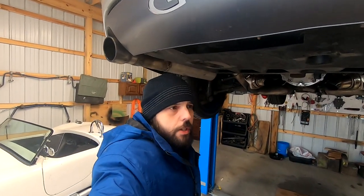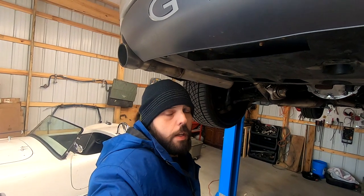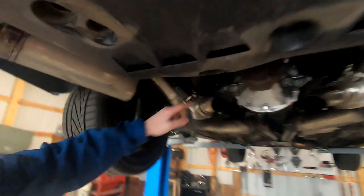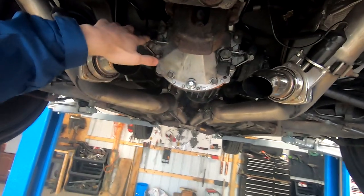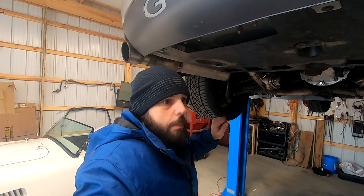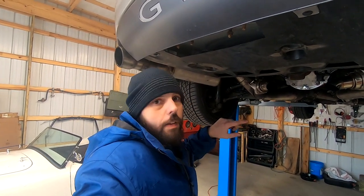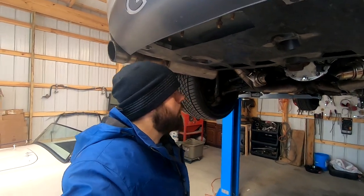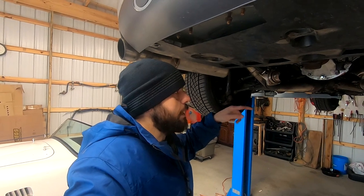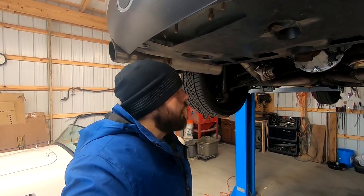Sorry for the continuity change — I'm bundled up today because it's under 30 degrees and pretty cold in the shop. While I was editing this morning the parts arrived, so I rushed out and got it done. The speed sensors are in. I had to use different bolts than the OEM ones — they were allen head and I was worried that if I had to pull them out in the future they might snap or round out. With a 10mm head versus an allen head, if these snap there might still be enough thread left, since I put a spacer on it, that I could turn them into a stud later. I'm going to take the car for a spin and see how the differential works.